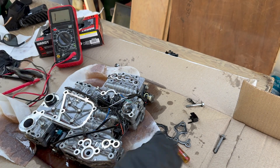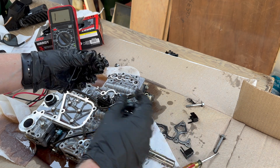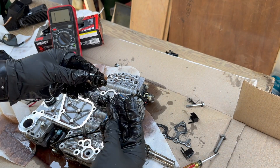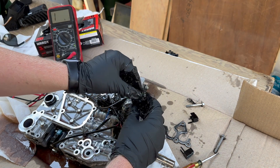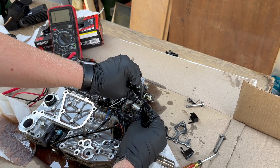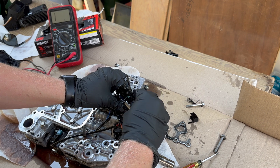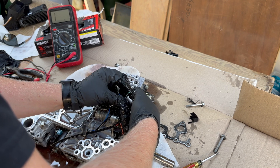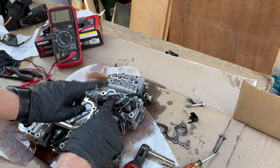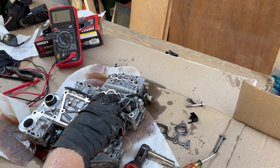This is the new one. Same thing — I've got to take the cover back off and slide it off. I'm going to take some ATF and lube up the rings. It sat in like that, so if you remember: gray on left, green on right. Throw this in here — just like that — and it just pushes back down. One done. I'm going to replace the other two since I have the transmission out and I have two more spares, so I'll change those out and be right back.